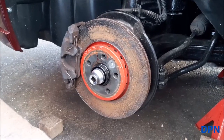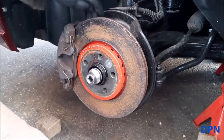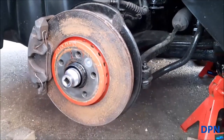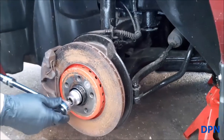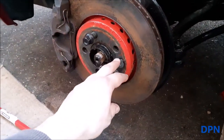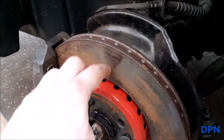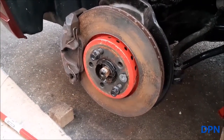That's the wheel off — quite a bit of rust on the discs. We're going to remove the hub nut first. There's also a little star-type screw bolt to remove as well, and we do that while the brakes are still connected so you can put your foot on the brake to grip the wheel. The hub nut was really, really tight. Looking at the discs there's quite a lip, and the pads are quite thin — they definitely needed changing.